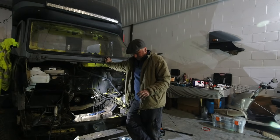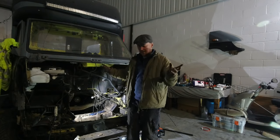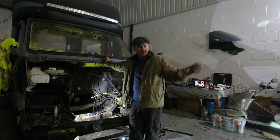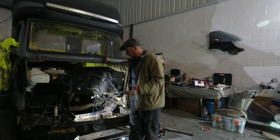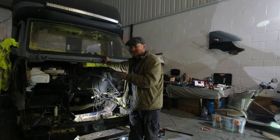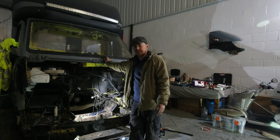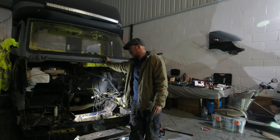The bar being a little bit longer is obviously going to blow my tracking out, but I'll just have to take the track rod ends off, wind them in a bit, put them back on, and get the van tracked when it's back on the road. And then eventually, I've got the 16-inch wheels sat outside still, and I'm debating whether to put them on or not. I have just managed to get Michelin Agilis CrossClimates on all seven wheels, so I finally match with all terrains. But if I put the 16s on, that means I have a load-rated wheel, and I can go for big knobblies or, you know, some proper all terrains, which is favourable.